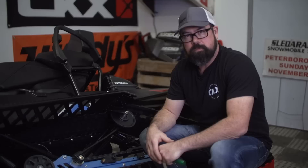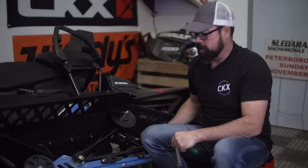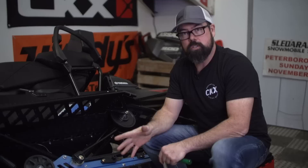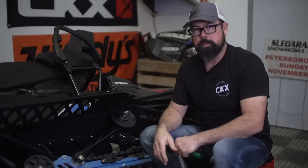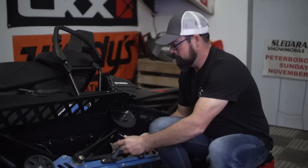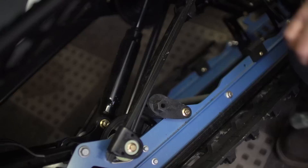This tip comes from a conversation I had with a rider a couple of years ago who really wasn't all that familiar with his machine. He was asking me if there was something broken in his rear suspension because there seemed to be something flopping around in there. He was wrong — he was referring to the overload springs that are in there, and they're meant to flop around. If you know what an overload spring is, go get a coffee — this tip's not for you. But if you don't: an overload spring is there to increase the load carrying capacity of your sled for those times where you've got a passenger on the back or you're hauling extra gear and want a little bit more resistance to bottoming out. They work really easy — just use your spark plug removal tool on this cam, turn it over, and snap it into place. There's one on each rail. When that load goes away, all you've got to do is use that same tool, back the cam off, and you're back to normal.